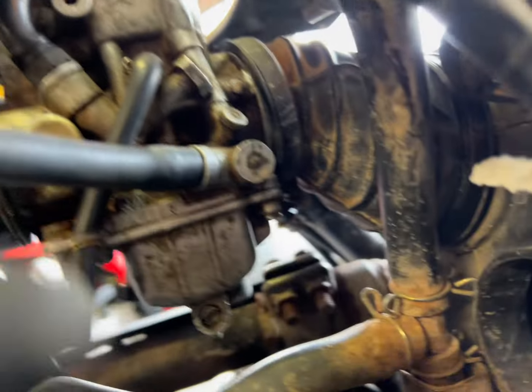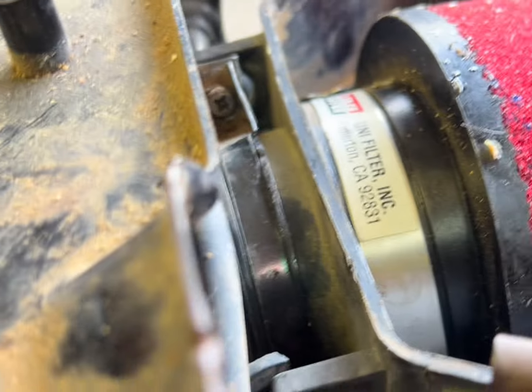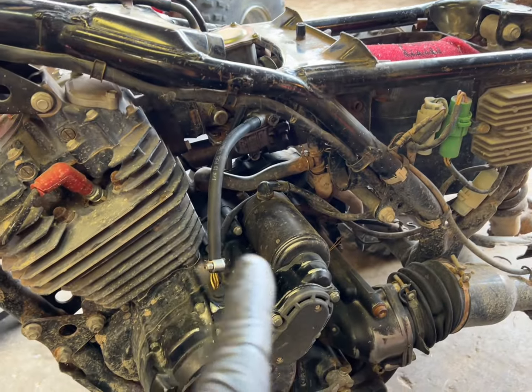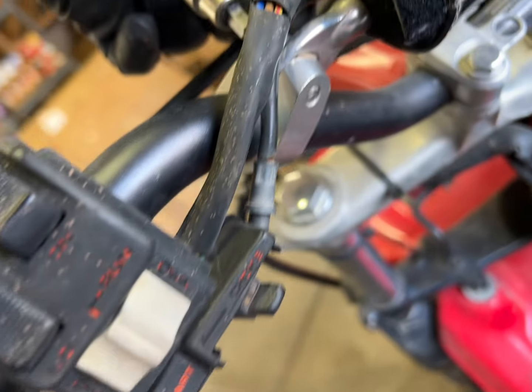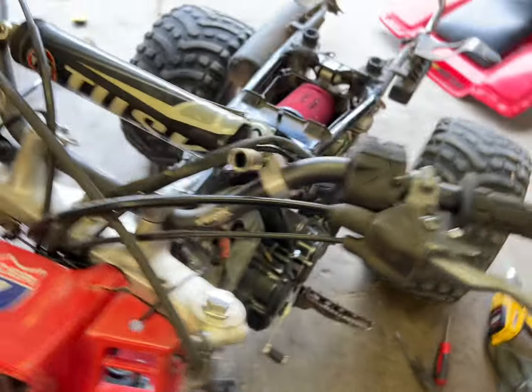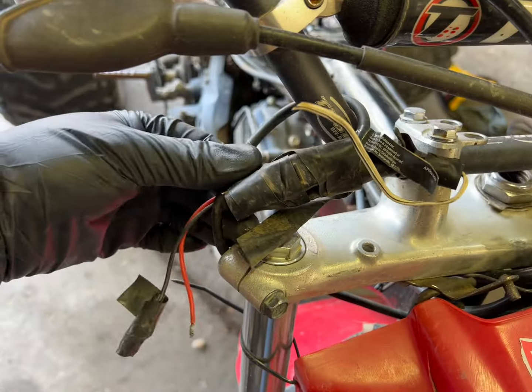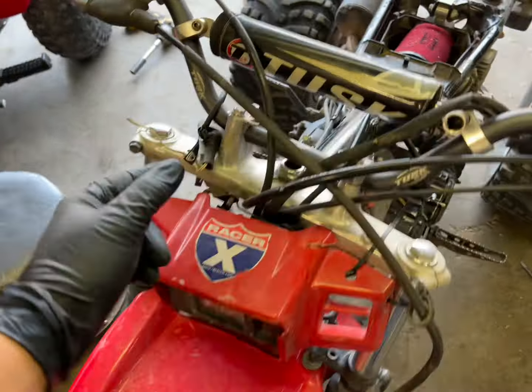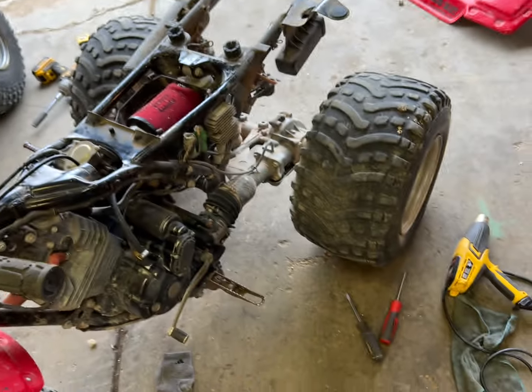Airbox is installed. This boot was pretty shot and very hard, so I heated it up for a couple minutes but it's still not sitting perfectly on both sides. When you try to clamp one side it pops off the other, but it's on there and it's going to work. Going to grab the tube that runs from the airbox to the frame out of storage - I have an extra one. Also, this guy ran his choke cable over the bars instead of through them, so it doesn't move easily. Also some custom wiring that looks terrible - going to pull the bars up, move the wires inside, and put it back down.